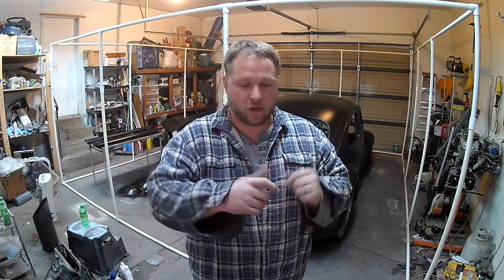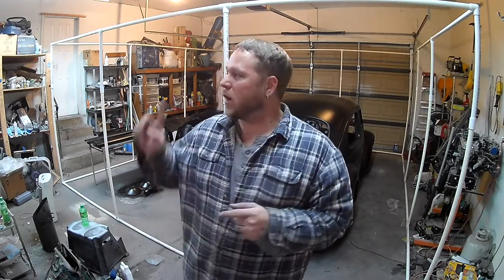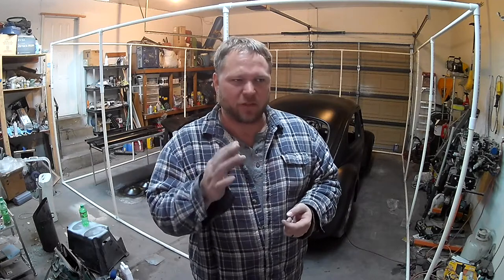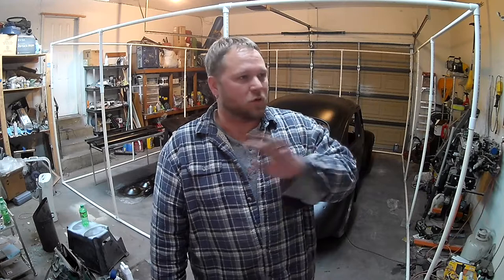I got a little better at tuning the gun or adjusting the settings, actually learning what those adjustments were. Because when I painted my Corolla, I think I randomly twisted some knobs and just went with it. I did not have a pressure gauge on the gun. I did not have a filter. Oh wait, no, I did have a filter on the gun, but no pressure gauge. And if I recall, the air compressor I had, I just adjusted for like 30, 25, and then learned way later, and why my paint sucked, is that the pressure drops when you pull the trigger. So that was throwing off what I was expecting versus what I was doing.